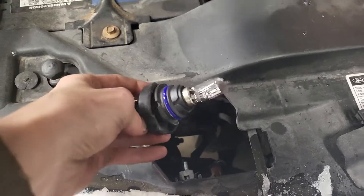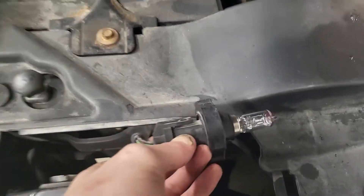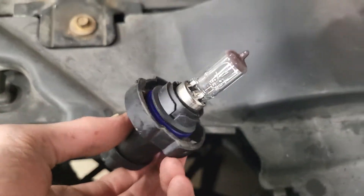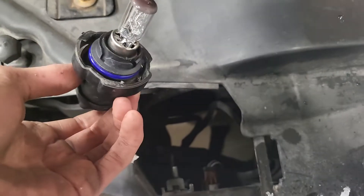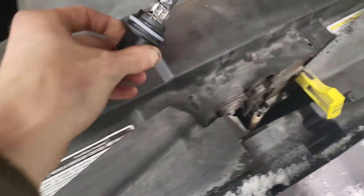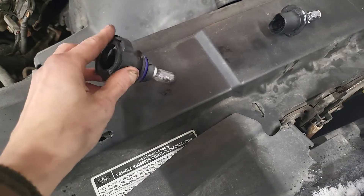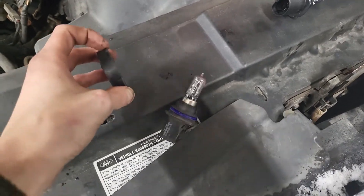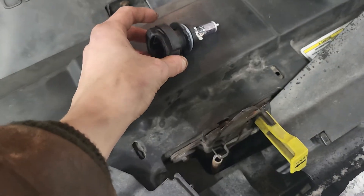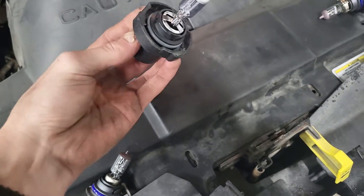So now, put your retainer ring forward and get a little flat blade screwdriver. Take off that little clip right there and the bulb should come right off. There's your old bulb, and there's the new one. What you do here is take the retainer ring off, make sure it's facing the right way — the cupped part goes towards the headlight — and you stick it on your new one, just like that.